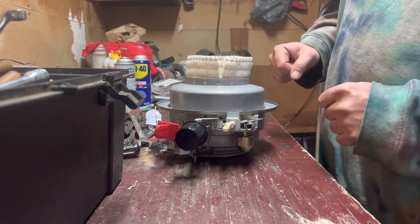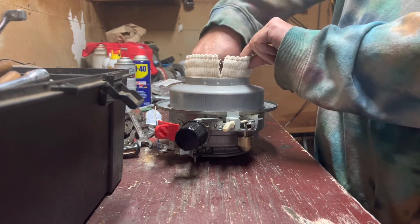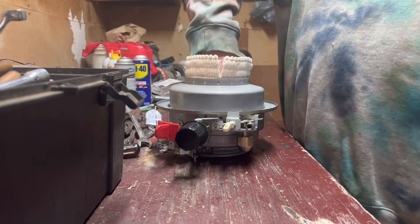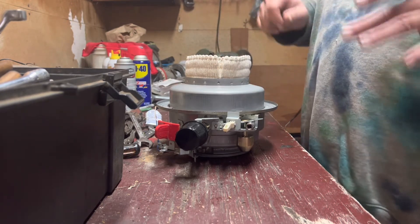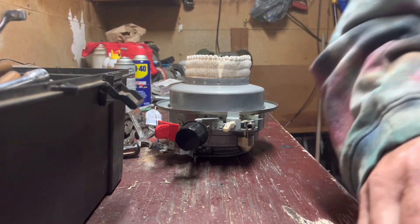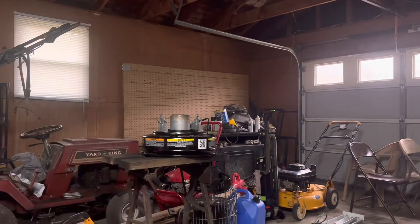When I took this heater apart, the wick was jammed up into the bowl and it's not supposed to be like that — it's supposed to be sticking down as such in order for the wick to soak up the kerosene and do its job. So we'll leave that thing wide open as such and try to actually slide it onto this heater. This could be a good shot.